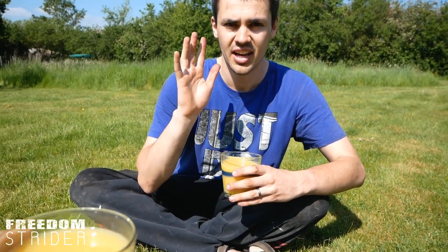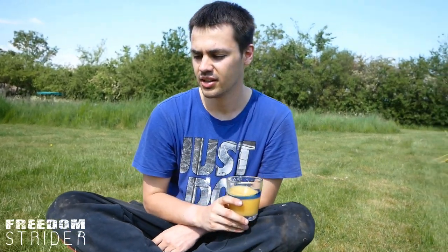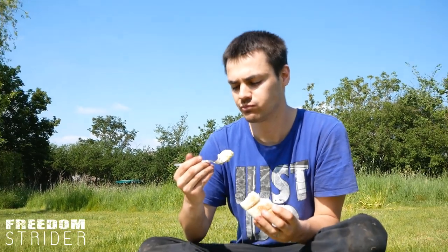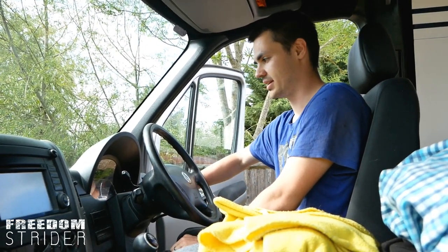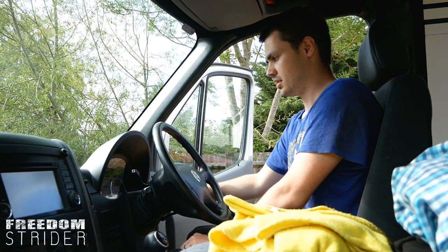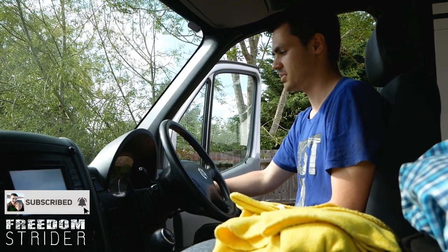The tank is back in and we're going to have lunch — it's suddenly turned summer here in the UK, about 25 degrees, so worth absorbing it. We just need to connect the blue fuel line to the heater after we eat. We've connected everything back together, so we're turning the ignition on a few times to prime the fuel lines since we emptied them a bit.